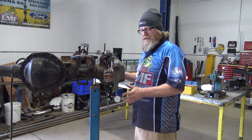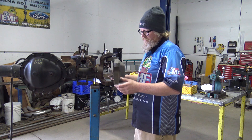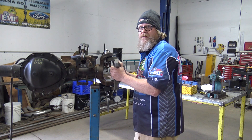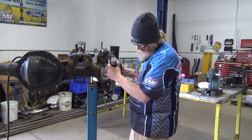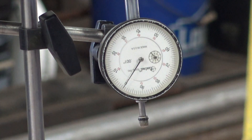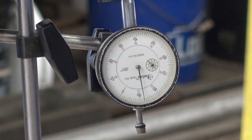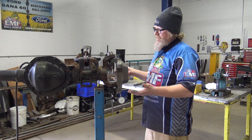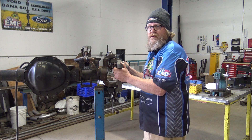This is typically the kind of play we'll see. Usually you'll hear an audible clunk or click when you're checking the ball joint — imagine you have a tire here and a bar underneath and you're moving it. These joints are dry so it's magnifying it, but that's 10 thou, which isn't a lot. So that's an audible clunk at 10 thou, and that's easily taken up by grease. Obviously these are dry for this demonstration, but this is typically what you'll see on a normal application.